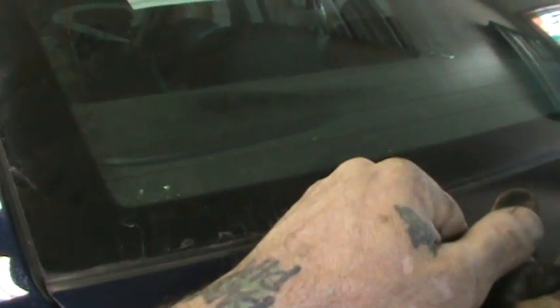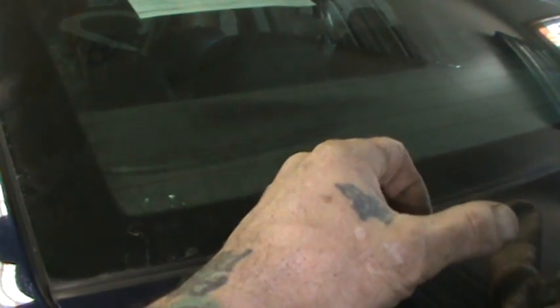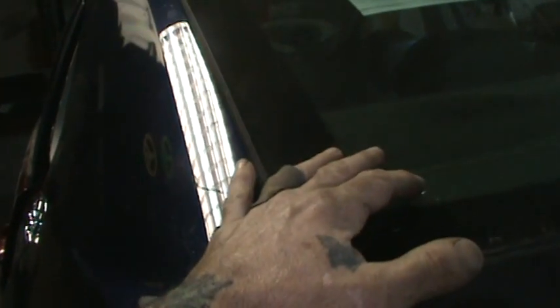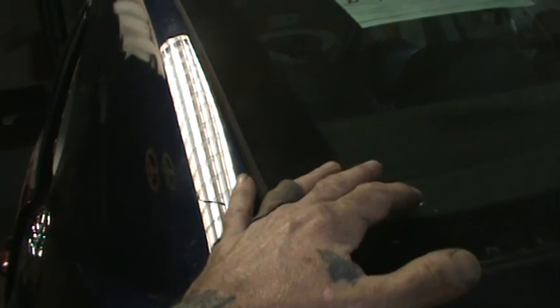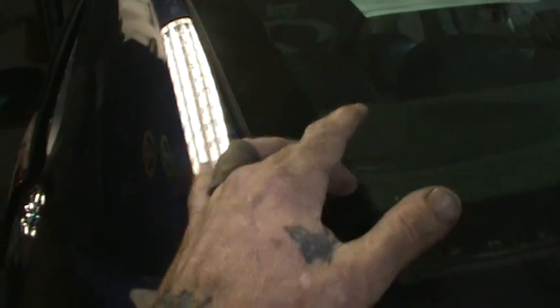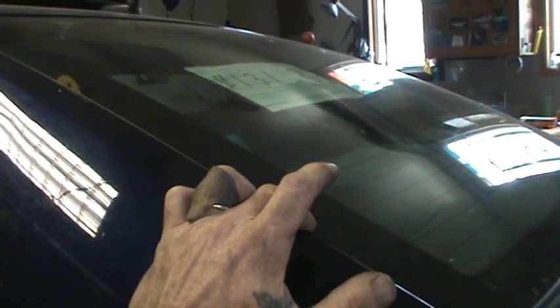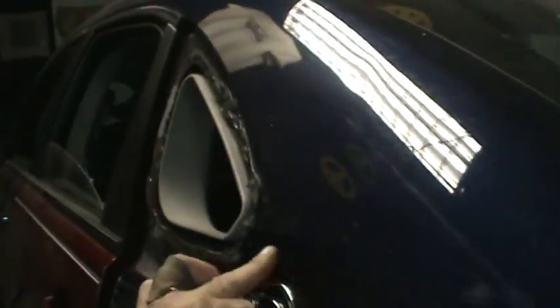I talked to a gentleman that's actually cutting this quarter off at the junkyard as we speak in the rain. He was taking a hook blade and a box cutter that you use to do shingles — he took the trunk off and did that — and then what he does is go in and heat this metal up to release the butyl to a certain point and then run a windshield wire through with two people. I don't know if I can get this window out. I just have to do a little body work there, a little body work here, and call it a day — all this would be hid underneath here if I leave this window in, because I don't feel confident.